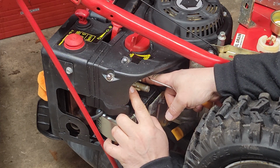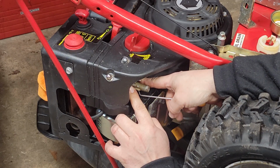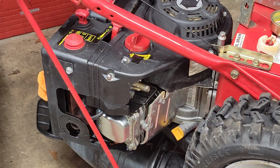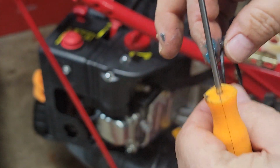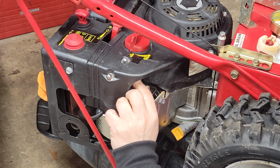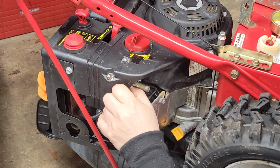I know you probably can't see what I'm doing here, but I'm trying to gingerly fit this gasket into the groove in there. Usually easier if I have grease. So we'll get a little grease to tack it up in there. So I'm going to tack the outside of it. Sometimes it's easier to get this to stay in there. Messy, but even if you get a little grease inside the carburetor, it'll pass through.